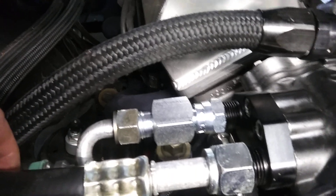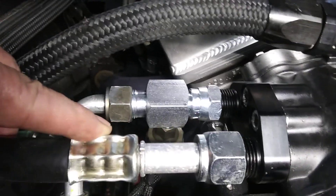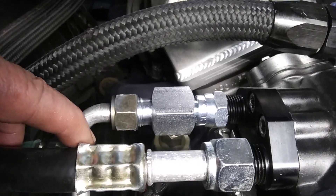To plug the thing in, I bought a new set of hoses. My sister's car has been converted over to R134a a long time ago, so I put a new set of hoses on, crimped these ends, got the fittings, crimped them on. Some parts came from Amazon, some from Summit — and then this is the important one right here.